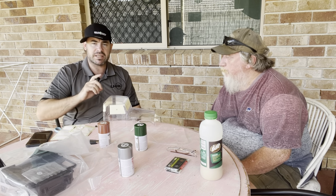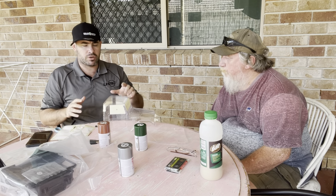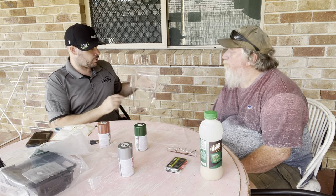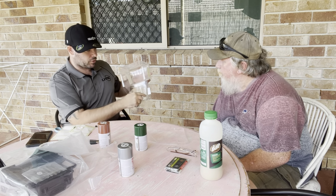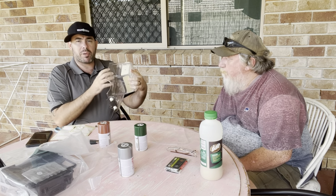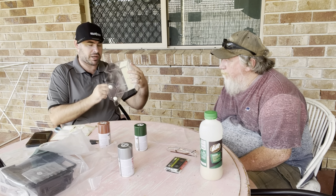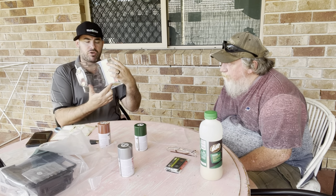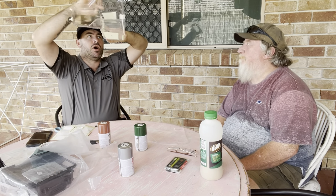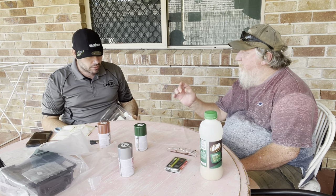So the first coat you do is a very light dust coat. You're not trying to cover everything in the first coat. The things that I focus on when I'm painting your primary coat are the corners and the creases. Things like the corners of the roof, the corners of the guards, the corners of the bonnet, and just all the corners, because if you put paint there to start with, as you start to run out of paint towards the end, it's easier to flick. But most people forget to do the creases first, and when you run out and you put the body on, when you hold it up to the sun, you'll see a nice clear line through all the creases that you've missed, and there's nothing you can do about it. So it's important to focus on the crease areas first.